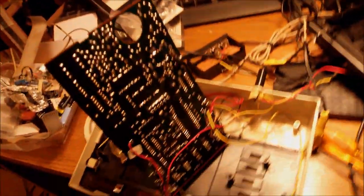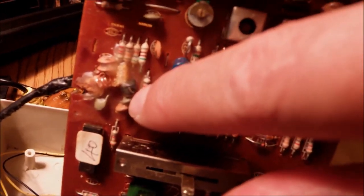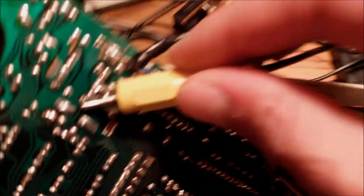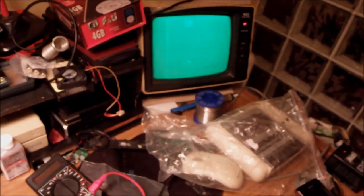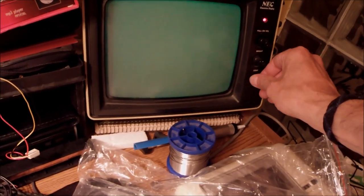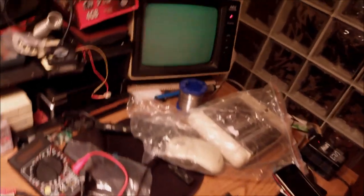I have the power on while I'm moving the PCB and flipping it over, just to check if there's a loose connection somewhere that might accidentally give a better signal — but that's not the case this time. Here we have the RF modulator, which is not a separate box but a built-in circuit. This makes it hard to check several things, but I found the transistor which receives and amplifies the signal before it goes out to be sent to the TV.